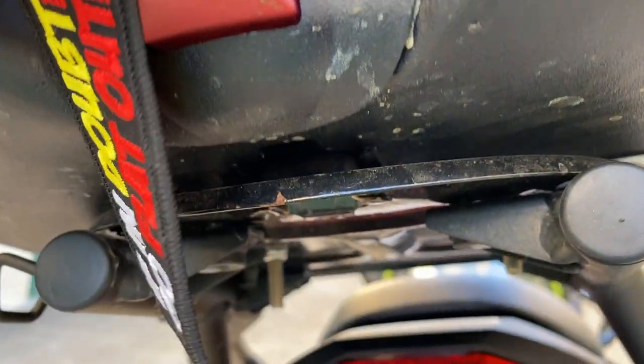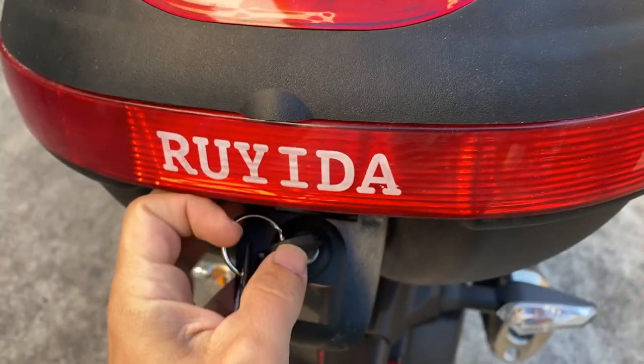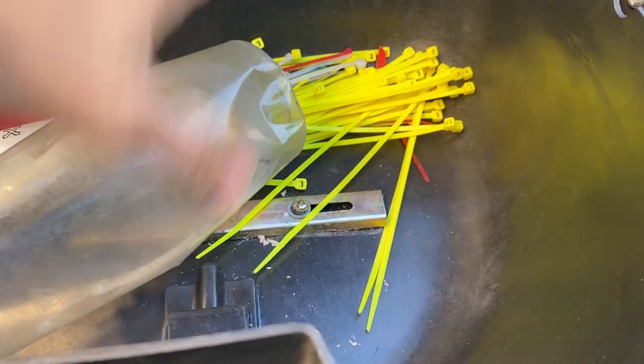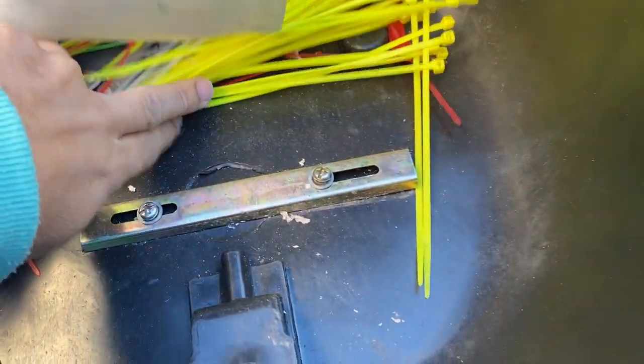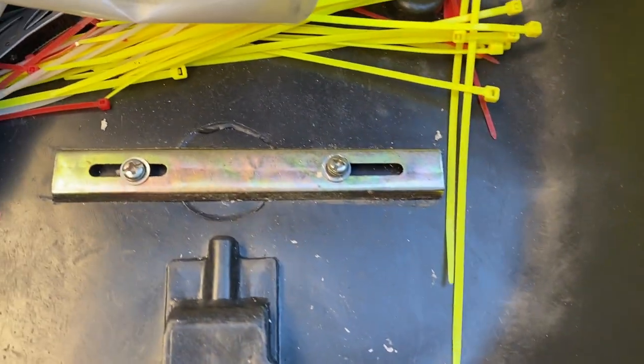The right hand nut actually vibrated off on the ride, so you'll definitely need nylocks if you're going to take this thing off road. Fair few vibrations, and here's my little dodgy piece up in the inside to make sure that the plastic isn't just going to crack in one spot, so it distributes the vibrations a little bit.